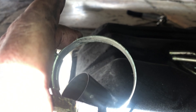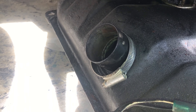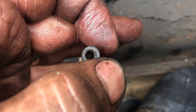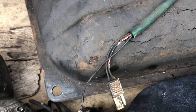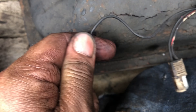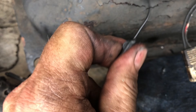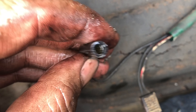I've got a replacement clip for the fuel — could be a jubilee clip, probably another brand. These are the wires for the sender unit — one looks a little corroded inside, so I'm going to take a screwdriver and scratch it clean, just in case, because I do like the sender unit to work. I'll score off any dirt that would prevent a good contact, then flush it with contact cleaner. So the pipes are reconnected. The tank is actually quite heavy even empty, so I wouldn't entertain doing this without draining it down first — it's a hell of a weight.